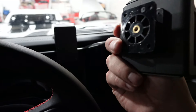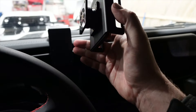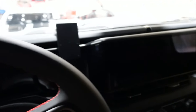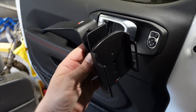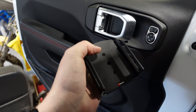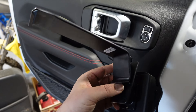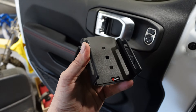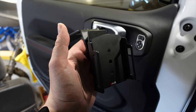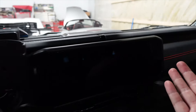We're going to take the screws that come with the kit and mount the phone holder to the center mount first, so I know I have enough clearance with the screen before getting everything in place. There are four screws that come with the kit, and you remove two screws to get in there and attach the mounting screws. With this setup you do have a little bit of articulation and can turn your phone sideways if you have enough room — which is why we want to mock things up first.